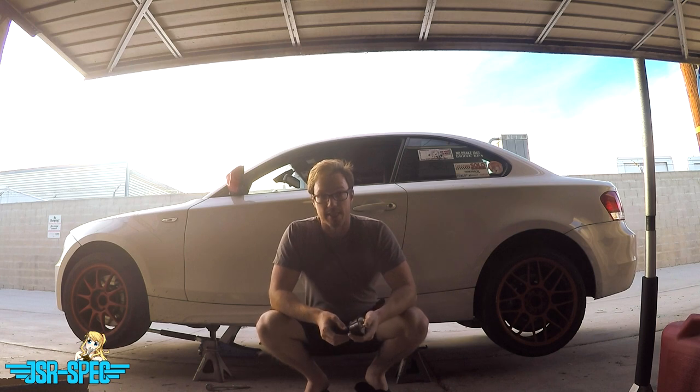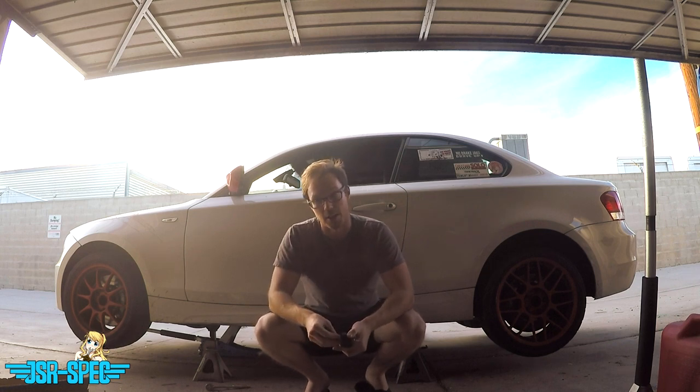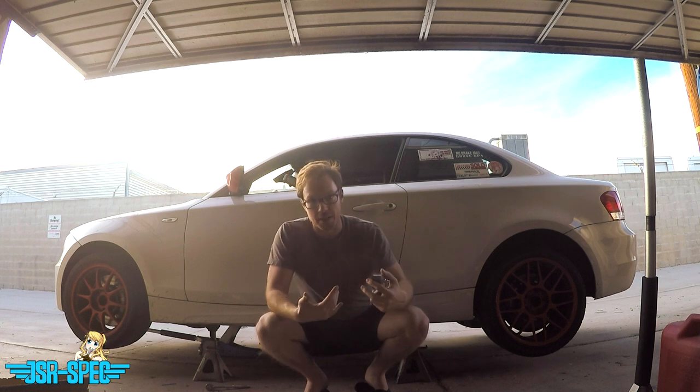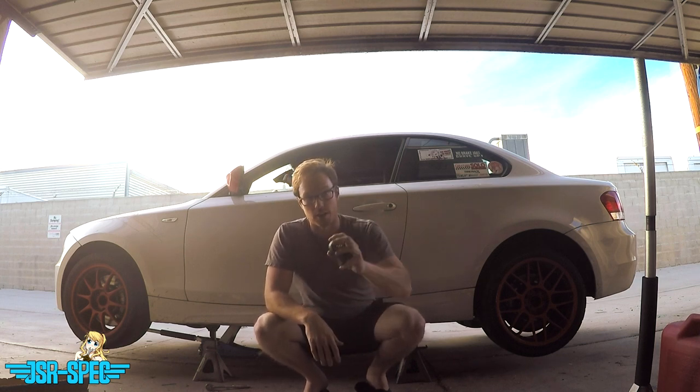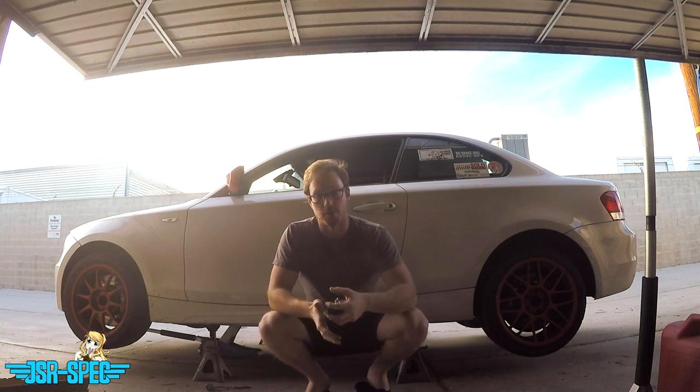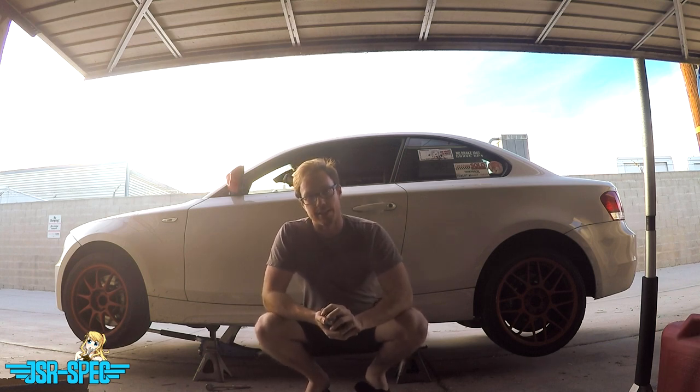Now, in some cases, that can cause missed shifts, and in some cases, it kind of just causes gear engagement to feel a bit funny when you're really thrashing the car. Because this is mainly a track car and kind of my fun car, I wanted to go stiffer. So if you're asking yourself, should I upgrade my transmission mounts, and what should I upgrade to? The answer is, it depends.